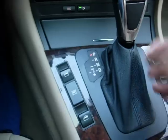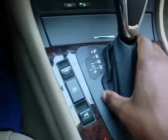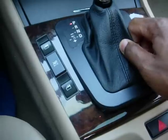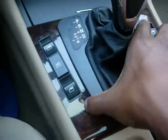Or off Craigslist for around $20 to $40. All you need is the plate, and under the plate all you have to do is switch two wires — there's a blue and a purple wire on that thing in the middle. Alternatively, like I did in my write-up, you can switch on the female side of the connector — I switched the two middle wires, which are a blue-yellow and a solid blue or blue-green wire. Just the two middle wires — you only switch one side.